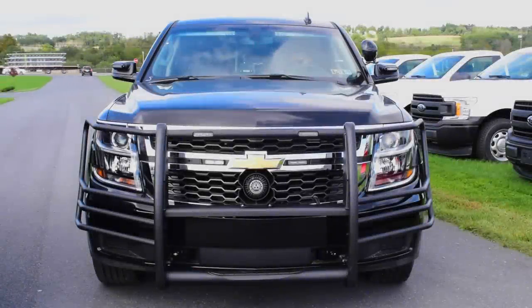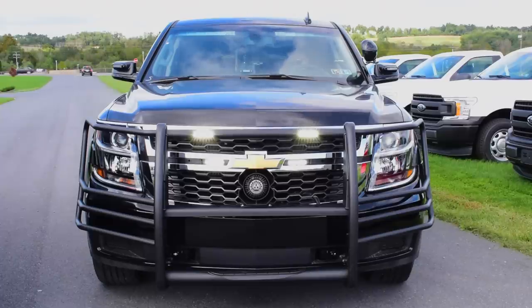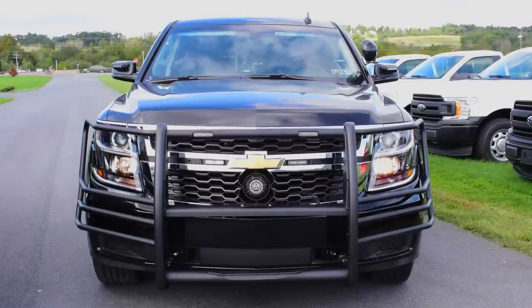With the camera outside the vehicle, I'll demonstrate the takedown functions. Press one activates the grill lights in a steady white configuration. Press two brings in the top push bar lights, also steady white. Press three gives the FST bar in front — it's a progressive system. Additionally, the customer has opted to have wigwags on a separate button, allowing them to enable or disable independently. The nice thing about Carbide is it lets you custom tailor the vehicle to your specific application, whether police, fire, or paramedic.